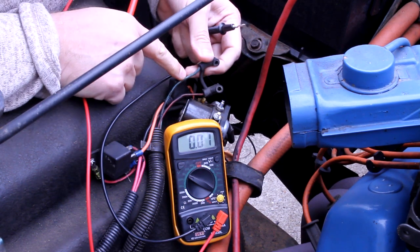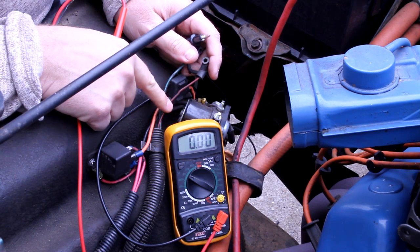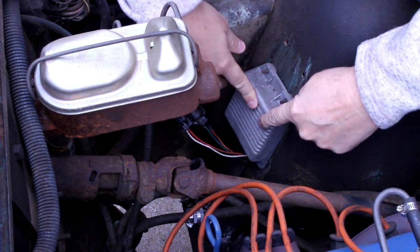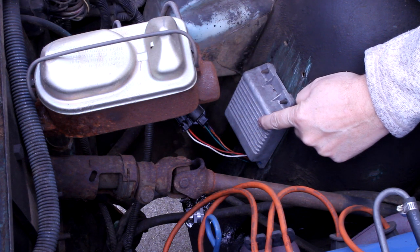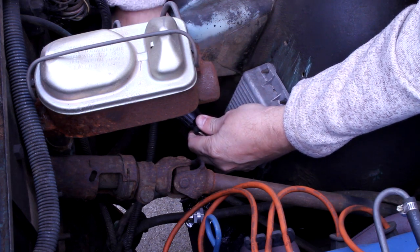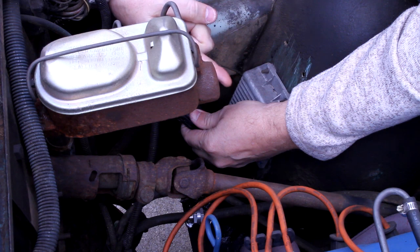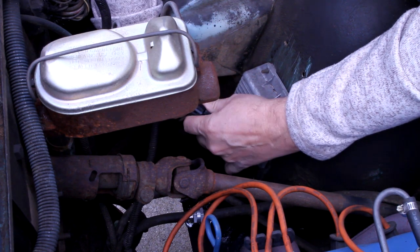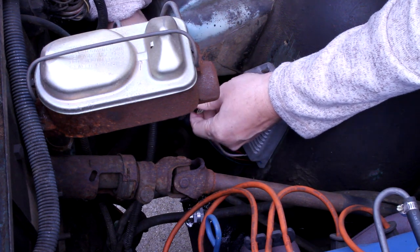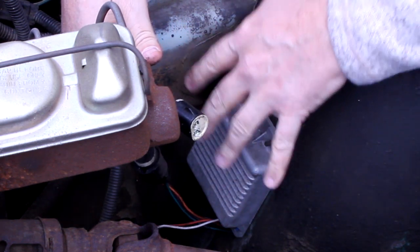So that start wire is good, but I'm not sure what that 6.2 volts means on the run wire. I want to trace back over to the driver's side of the firewall where the wires come through and do some testing there. On this side, here's the ignition module — I had that highlighted on the diagram — and right here is the pass-through at the firewall. According to the diagram there's a junction where that baby blue wire splits to the starter solenoid, but here it comes into the ignition module. I'm going to test again for start. Here's also the red wire with a white tracer — when I traced that back it's also that other wire. I'll pull these off and test them.